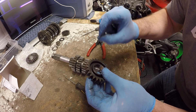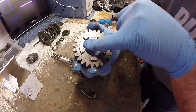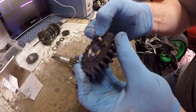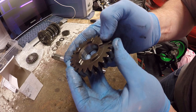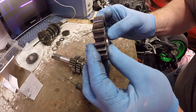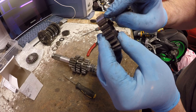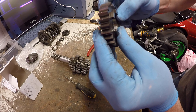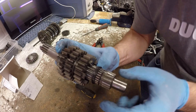The gear wheel now comes off. You can see the washer there - that's a once-only item as well. Now you can see the teeth and you can see wear marks where it's been smashing backwards and forwards against the other gears. There's some marking on the dogs and there's excessive wear on those dogs as well - this is where you get that feeling that it can jump out of gear. There are some really sharp burrs on there too. The real reason we're replacing it is the gear teeth damage, which is an early sign of failure - it would eventually propagate into a crack, lose a tooth, smash the gearbox to pieces, and require a full engine rebuild. We caught that nice and early.